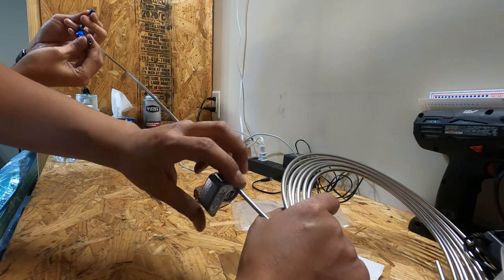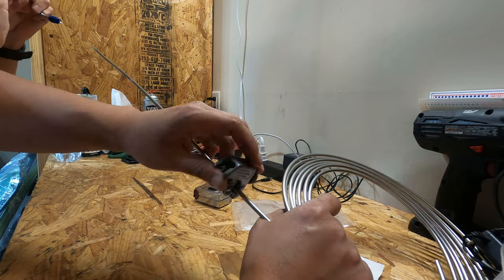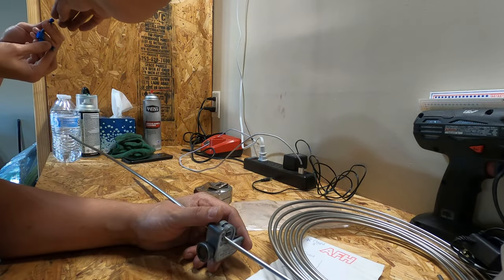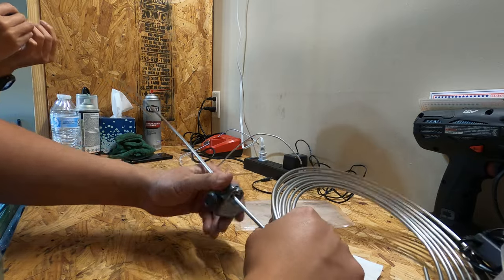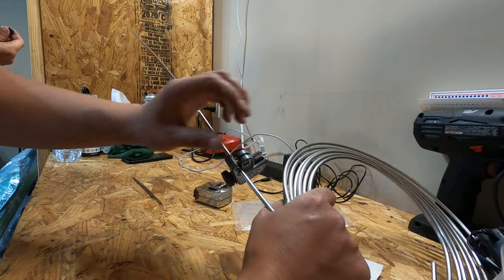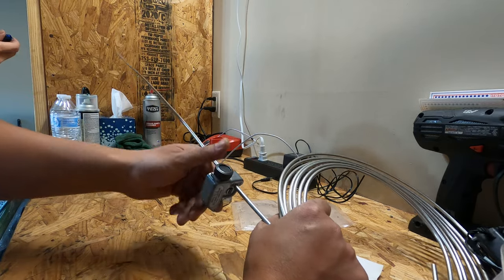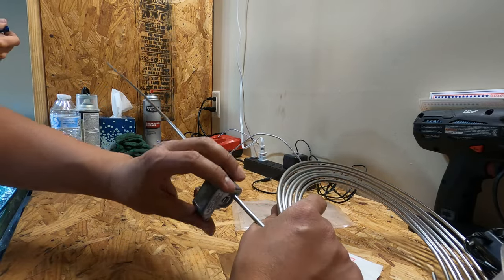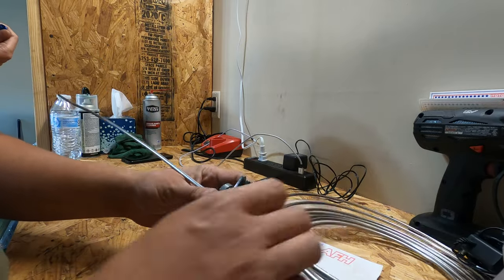You see how this tube nut is? You see this one's more flush? It's because this is the new one I got. It's because the inside is not as flared. Is that gonna be an issue? Nah, you're more worried about this. This is just pushing it in. And it's squeezing over the tubing. So you'll be fine. This metal is softer. So when you squeeze it, it'll squeeze in on it. It's kind of like whenever they do the blocks and they put copper rings, they know that metal is a lot softer and it doesn't rust, so it'll mold into wherever it needs to be. So you'd be fine. Good.